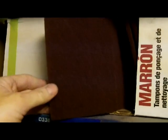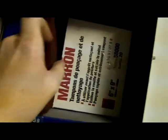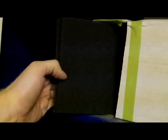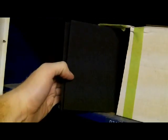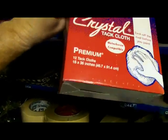Red Scotch-Brite pads for scuffing paint that you're going to put base coat or primer over. Gray Scotch-Brite pads, which are a finer grit, probably like 600 grit, for doing your blend area that you're just going to put clear over, most likely, or have just a little bit of base onto. I suggest tack cloths. Some people don't like them. That's fine too, to pick up the lint or anything that's fallen on your panel before you paint.